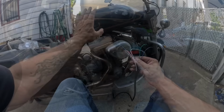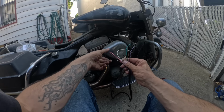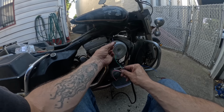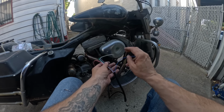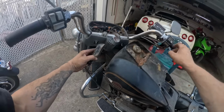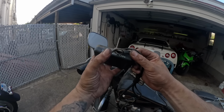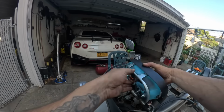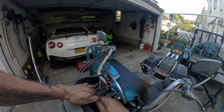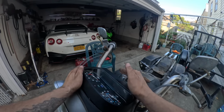So okay, timing plugs done, plugs are back in. Power, coil trigger, tach wire, vacuum operated electrical switch, blue not used. We'll get this installed. Okay, it's sort of temporarily put together. Here's the original ignition module, 1284. We're actually going to learn two things in 2 seconds, I guess: if I installed everything correctly, and if the module was indeed the problem.